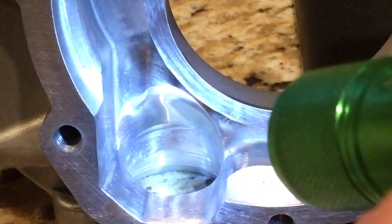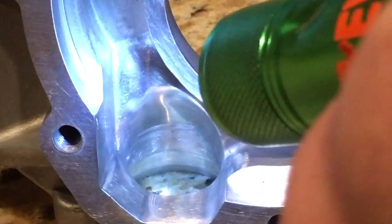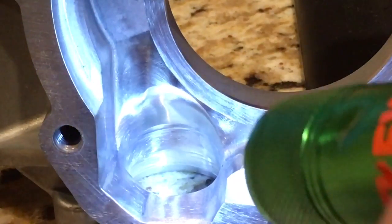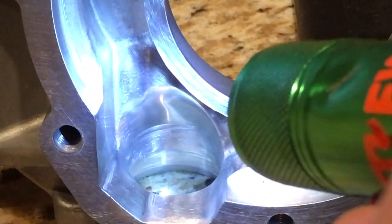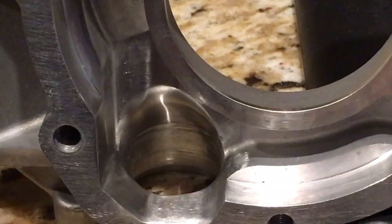I removed the surface texture to a fairly fine finish using a Scotch-Brite ball, removing all of the texture specifically in the entrance area and the first part of the pump cavity as much as I could reach. The Scotch-Brite balls don't go down too small because the arbor that holds them is a certain size. If you own a Dremel with access to small polishing drums, you could do more polishing in the floors of these pump cavities. Basically I radiused that opening, removed as much surface texture as I could in the inlet area, and smoothed that ramp to blend it into the floor of the cavity.